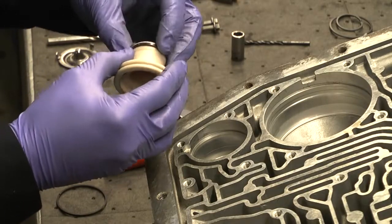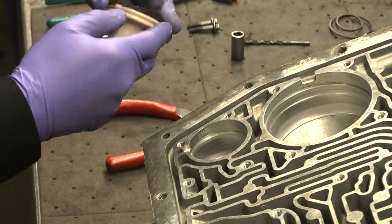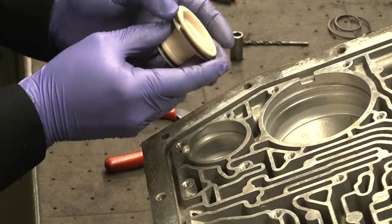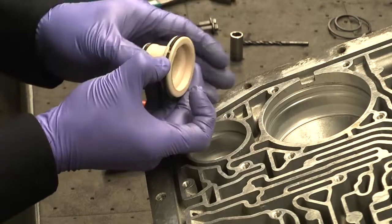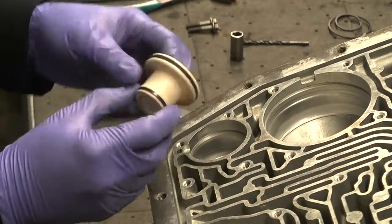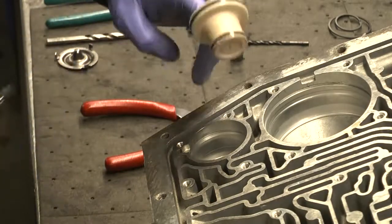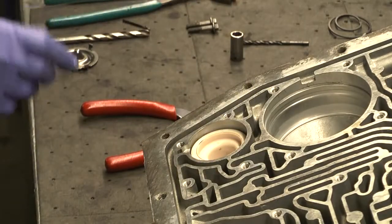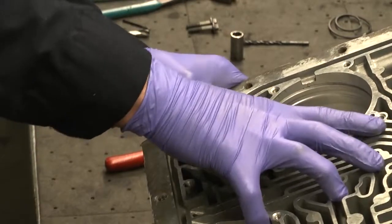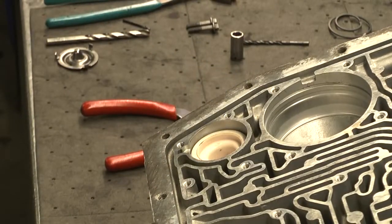Make sure the ends overlap properly. And the larger ring is actually a metal ring. That's a hook type ring, and just see how that goes together there. There you go. Now a little grease or oil or STP for assembly will make it much easier. You take the butt end of a screwdriver or a light hammer and just kind of tap it in.